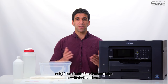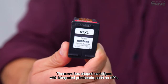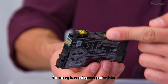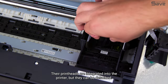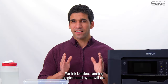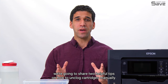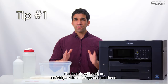If running a printhead cleaning cycle doesn't work, we recommend cleaning it manually instead. It's important to note that printheads might be situated on the cartridge or within the printer, so cleaning them will slightly vary from printer to printer. There are box-shaped cartridges with integrated printheads such as HPs, and thin cartridges without integrated printheads, for example most Epson printers — their printheads are integrated into the printer but can be detached. Now let's share two helpful tips on how to unclog cartridges manually.